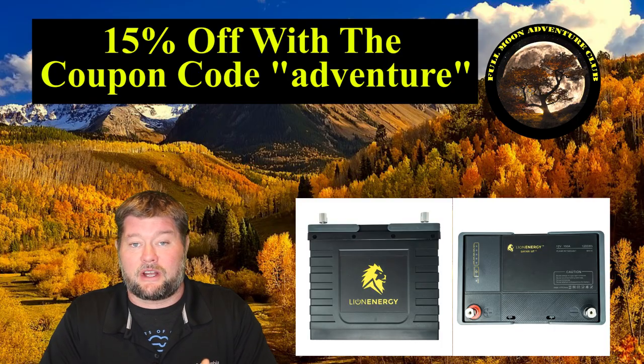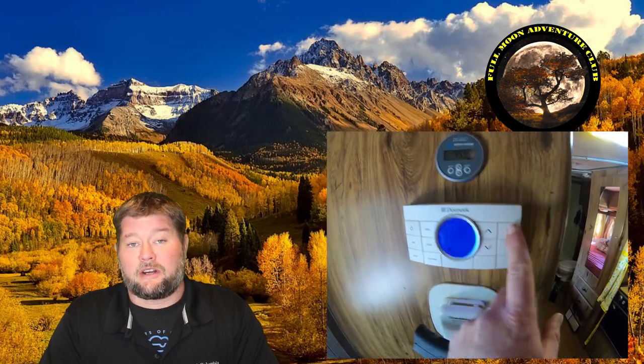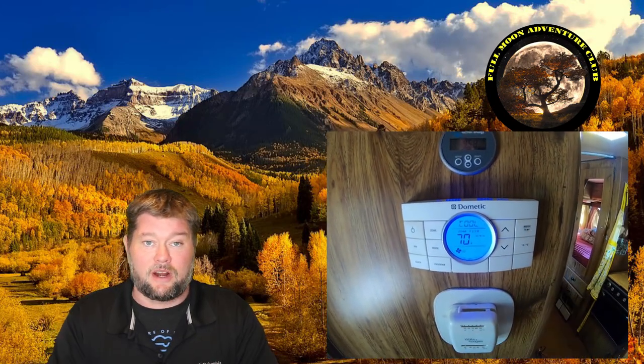For this test, we're going to disconnect the RV, disconnect the solar, fire up the air conditioner, set all our timers, record everything, and just see how long it goes. I've disabled the low voltage cutoff on my inverter, so we're going to run these until the lights and everything just kick off. I didn't do that in the last test because I was nervous about damaging the compressor, but with the Easy Start 364 I think that'll help protect it — so I'm going to let it run all the way down to zero.